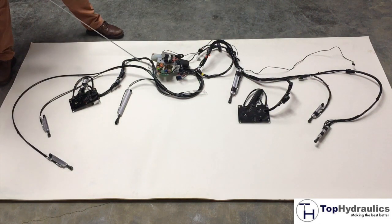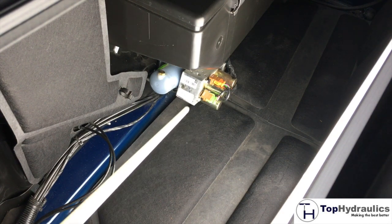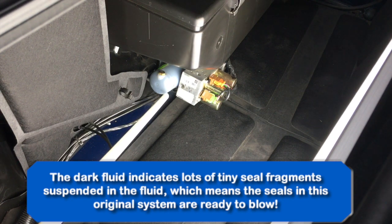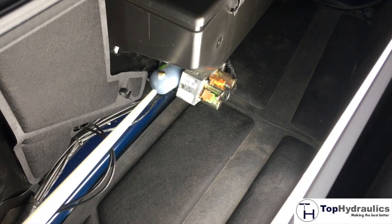Note on the pump's reservoir that there's a minimum and a maximum line, and on this pump you can clearly see that the fluid is just at the maximum line where it's supposed to be when the top is fully retracted. Here's the pump again with the protective cover removed in the middle of the storage compartment. You will see the fill port for the hydraulic fluid and if you look very closely you will see a maximum and minimum marker at the reservoir.